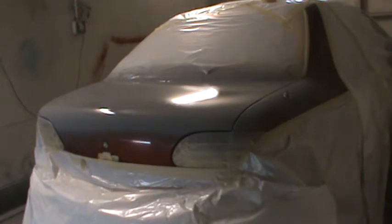And you know, if you were doing a proper repair, you would edge prime that, you put some sort of a 2K primer on it, and sand it the next morning, and seal it, and shoot it. So we've eliminated the wait overnight, prime it and sand it, and we've gone right to the seal and shoot it.